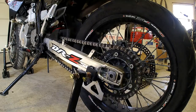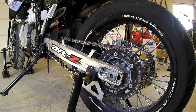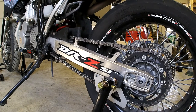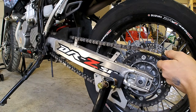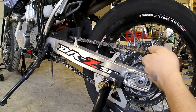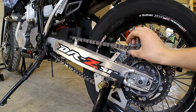I'm going to throw the bike in gear just so it doesn't roll on me. Now, normally people would just cut this chain off instead of fooling with the master link, but this chain is still in pretty decent shape. I'm going to just pop this master link off and keep the chain intact. You can put your flathead screwdriver right here and just take a hammer or a rubber mallet — you should be able to force it off. Just like that.